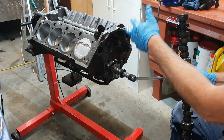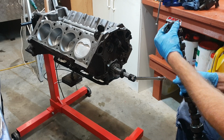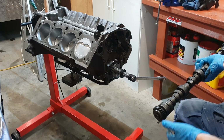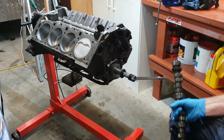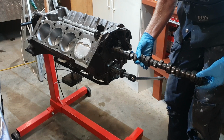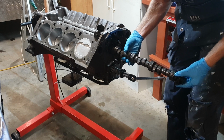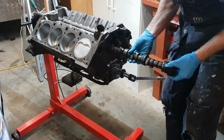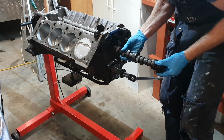I mean, because I'm going to prime this engine, guys, remember? I'm going to do that accumulator trick again. That's a really good little trick. Prime up my accumulator, put some pressure in it, and flood about 1 litre of oil through the engine. I just hand feed it in, guys. Look, I'm no pro. I'm just having a go. There's special tools that you can do this with. I just take my time.